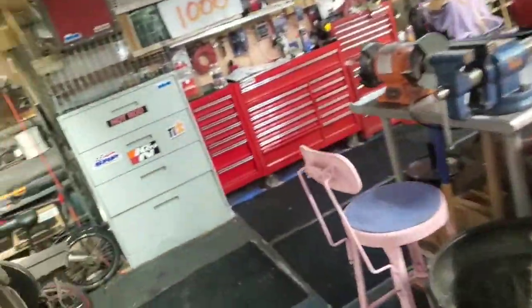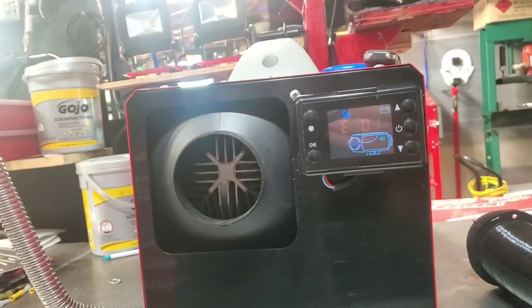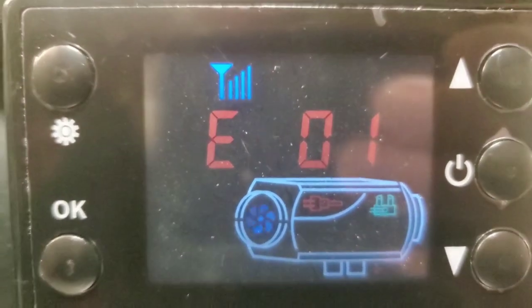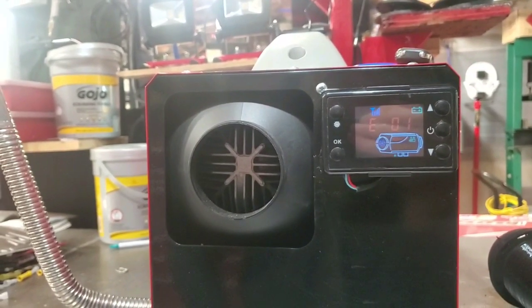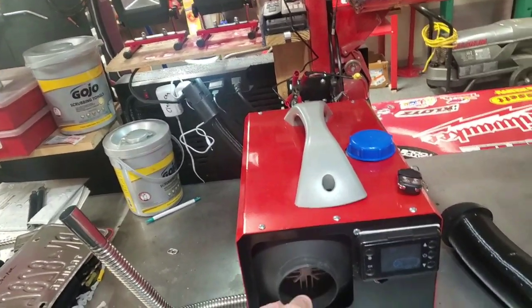It's pegging the meter — this just doesn't have the power right now. I've been neglecting this battery, should have gotten a bigger charger on it sooner. So now you see one of the problems you could run into: if the battery isn't big enough to carry the load when this thing starts, you'll get that Error 01 and the battery indicator flashing, telling you right there your battery can't handle it. If you're running it in your vehicle, just start your car and you'll be fine.